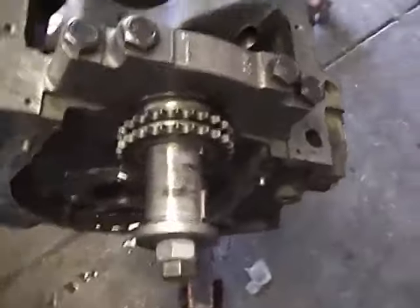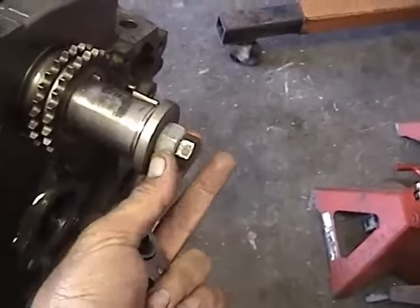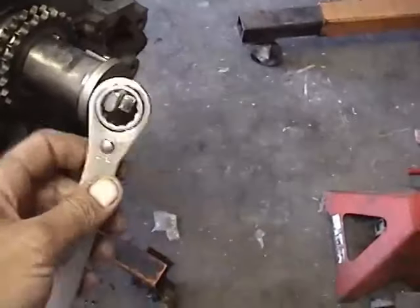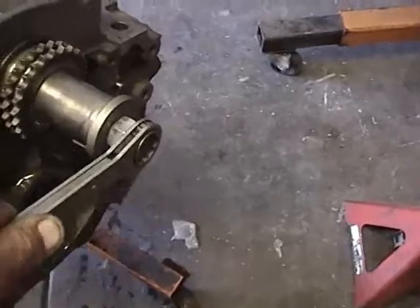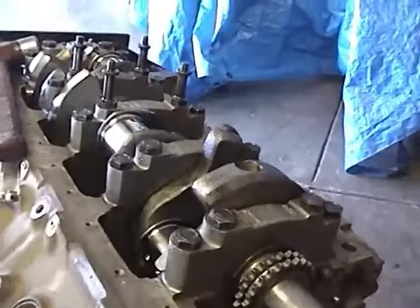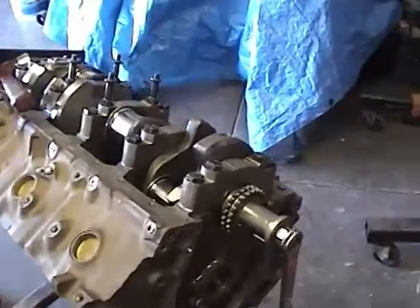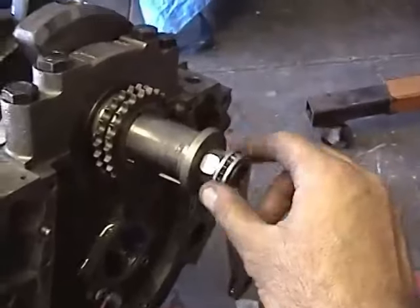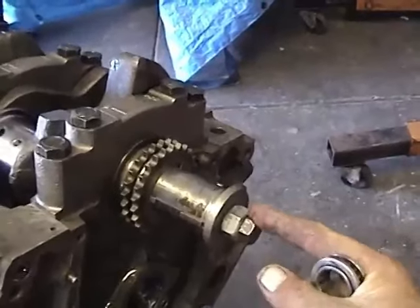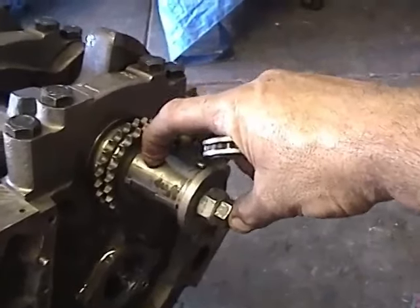Now that we're ready to install these pistons, let me show you what I've done here. I've taken the original crankshaft bolt and spaced it out with an oversized nut — it's not even threaded on there, it's so big, just used as a spacer. I used the existing washer and screwed it right into the crankshaft, and I'm going to use that to crank this engine over while I'm installing the pistons. Just to show you what a good fit we have here — this is what I call the one-finger rule. If I can crank this engine over with one finger, that's a good fitting crankshaft. That thing's going to last forever as long as we keep oil going to it. The reason I spaced that bolt is because if you bottom it out, you can end up damaging the thread, so I keep it spaced out a little bit so it's on a clean thread.